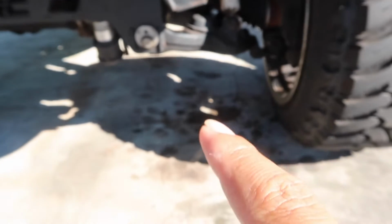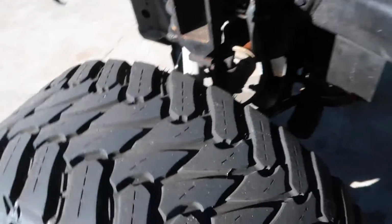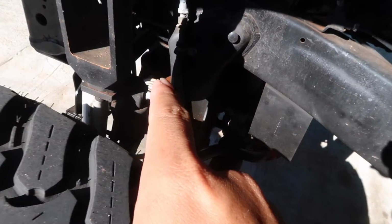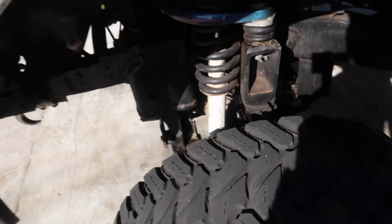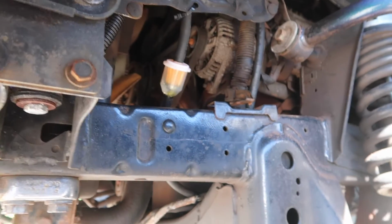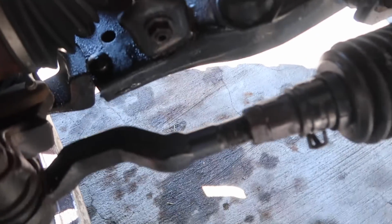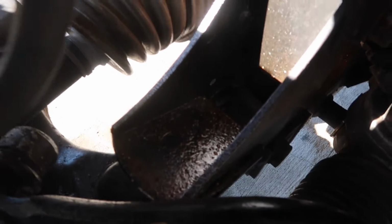I don't know if you guys noticed, but I have a leak like right there, and I noticed that it has been coming from my differential breather. So I kind of already hooked up a breather to it yesterday because I had work in Kaneohe today, and I've been working in Kaneohe the past week, and even went all the way to Waialua or North Shore side, and I noticed that every time I would drive far it would always leak. You see all of this stuff, these parts, I kind of wiped it down though, but everything is wet underneath.